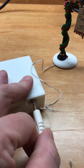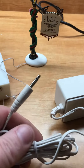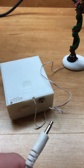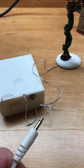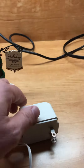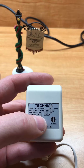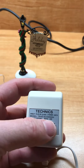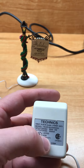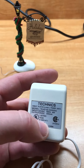It won't go in these holes. That's okay because these are kind of designed for some other items that are still three volts DC - usually older type items - and this plug will work just fine for those. On the back: three volts DC, 500 milliamps. That 500 milliamps could change depending on what you're looking at, but usually in the three volt DC range you're going to be looking at 500 milliamps.